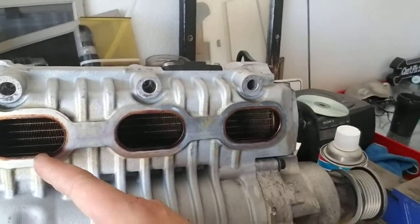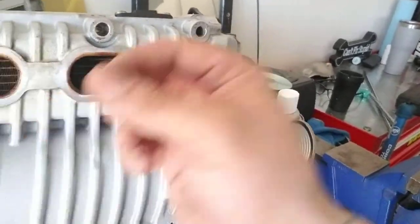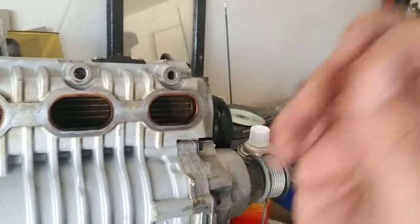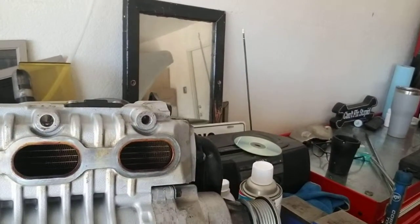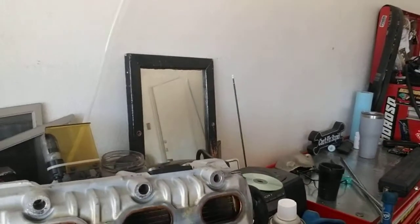Pull off your supercharger seals, or the intake seals. That's these things right here. On the car, they'll be green. Gently pull those, clean those. If you have any with a tear in it, replace them. They're not expensive. Unless you wanted to start this whole process with buying all the seals, all the gaskets, just in case.